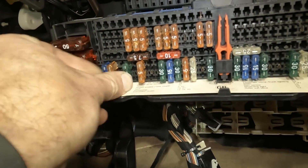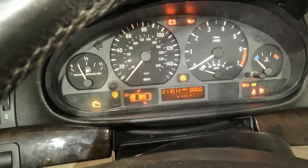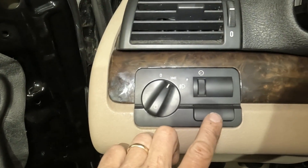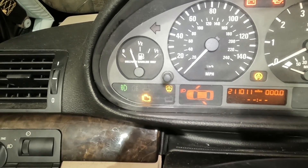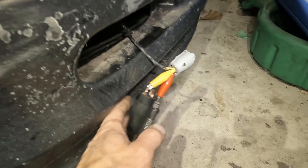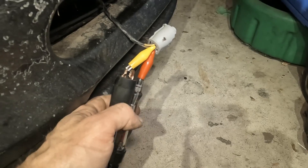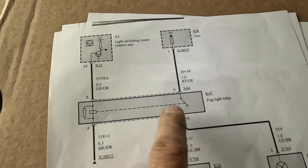Let's put it in and check our fog lights. For the fog lights to work, the key has to be on so all your cluster lights are on, and you have to have your switch in either parking lights or full lights. Press the button and at the same time you get a green indicator in your instrument cluster, meaning it's sending the signal that the fog lights are turned on. I'm back-probed into the connector for the fog light and my test light is not on — I am not getting power down to my fog lights yet.